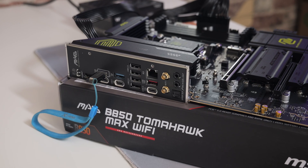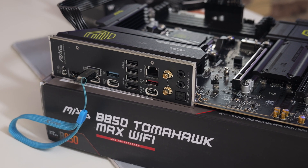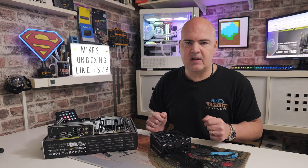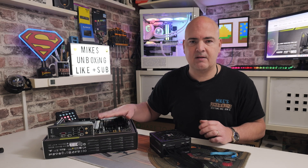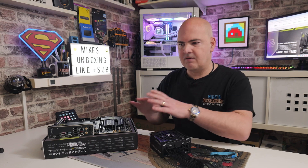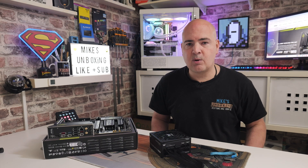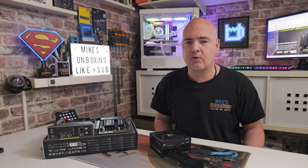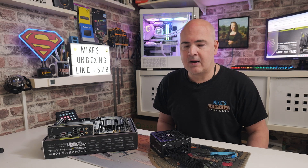You also need some form of platform to assemble it on — I'm just going to use the motherboard box, which is absolutely fine. If you've already built the PC and it's not working, you can do the flash in a fully built PC. However, I generally recommend doing it on a completely empty platform so that if the BIOS flash doesn't work, you can rule out anything else being connected — it's literally just the bare board. With all that said, let's head over to the computer.